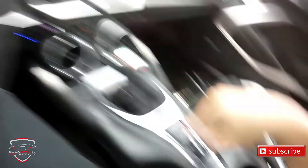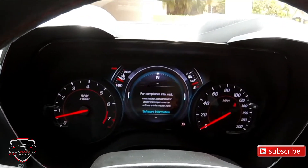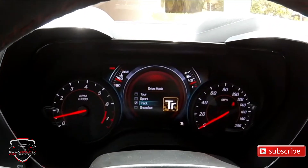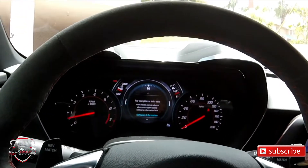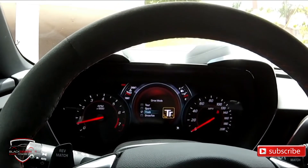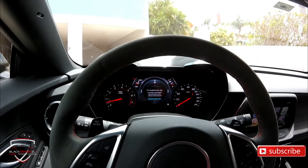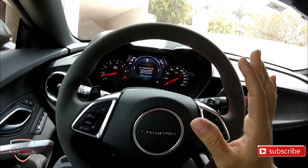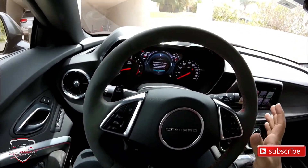Here in the center we have the drive modes. We have Tour mode — like for casual driving, the exhaust quiets down a bit. Sport mode — the exhaust sounds louder. Track mode — for the circuit. And Snow/Ice mode — which can also be used in the rain. These modes modify the exhaust sound, the throttle response — how aggressive the accelerator is when you touch it — and the steering weight, which gets heavier in Track mode and lighter in Tour mode. If we had the regular ZL1 with magnetic suspension, those modes would also adjust the suspension stiffness. But on this car the suspension doesn't change with the modes, because it is a fixed race-spec suspension designed by a company that makes suspensions for Formula 1 cars.